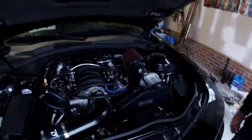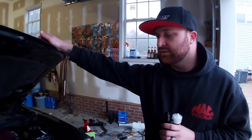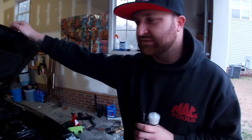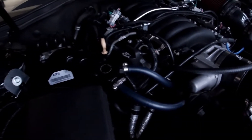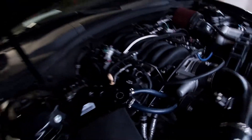There's an Eaton Detroit TruTrack positive traction differential with AAM factory 3.91 gears, a factory two-piece driveshaft that's going to have to change, and stock axles that are going to have to change too. There's also a Mishimoto baffled catch can — his is slightly different than mine, obviously Camaro versus Mustang. It's got a ghetto mount now since the charge pipe got in the way of the original radiator support bracket location, but it's still sturdy.